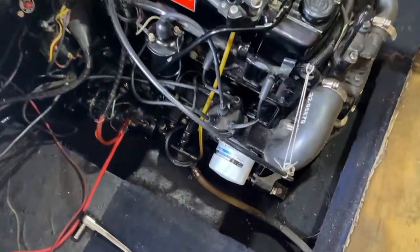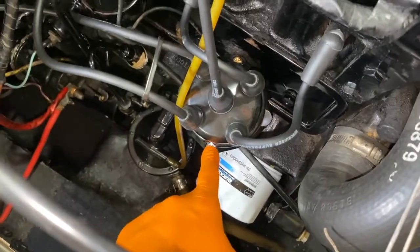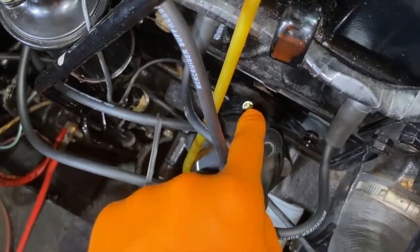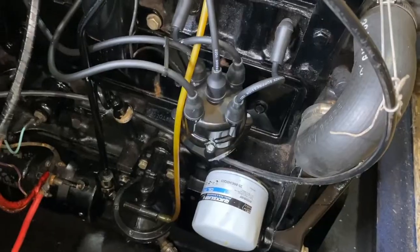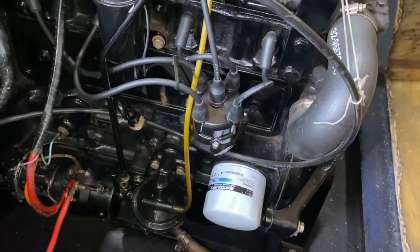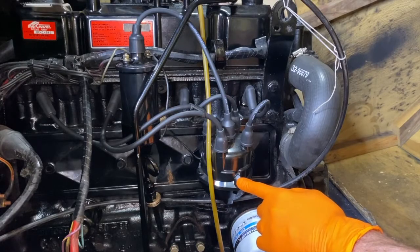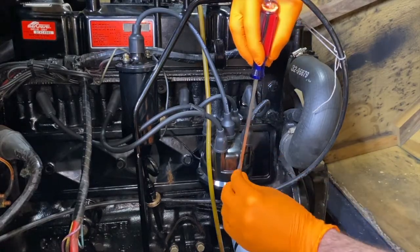Taking a big step back, I want to give you a very good top view of the distributor cap and direct our attention to the screws. The starboard side screw is more of a chrome or silver, and the port side or inward screw is more of a brass or gold color. Don't mix those up. Take a lot of photos before removing any parts or disconnecting anything on your ignition system. The starboard side is a silver or chrome screw, and the inner or port side screw is more of a brass and gold — so don't get those mixed up when it comes time to reinstall and secure everything.